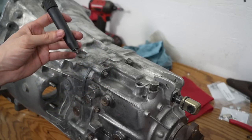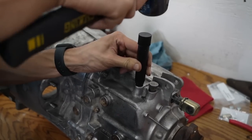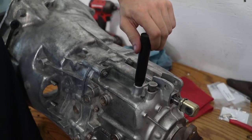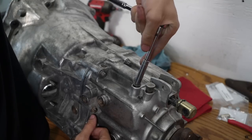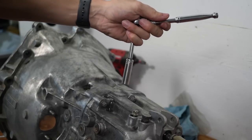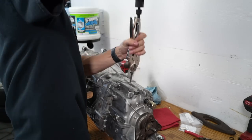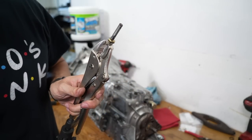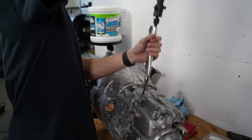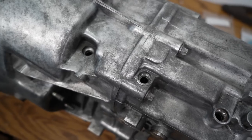This is one of the BMW specialty tools — I'm gonna see if it works to take these out. I don't know why I didn't use this last time. That tool made a little hole. I'm putting this huge screw in now, hopefully I can get better grip onto the slide hammer. It comes with a new spring so I don't have to worry about that — a screw big enough will hold on to the spring and bring that cap out. That was brutal — now that all the caps are off, I can breathe.